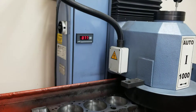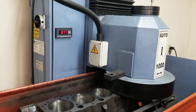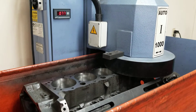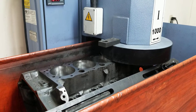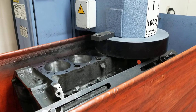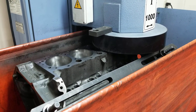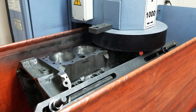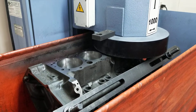Back into our rotary broach here. This is going to be a 383 Chevrolet at its last stages of machine work. What we do typically is get it on a stand, subassemble the piston rod onto the crankshaft with the wrist pin in place. We'll put that piston in number one, number seven, number two, number eight, and take note of our findings as far as the top of the piston in relation to the deck.